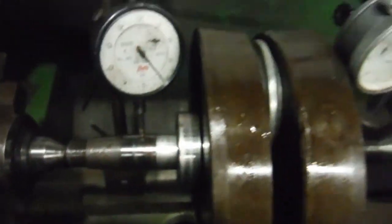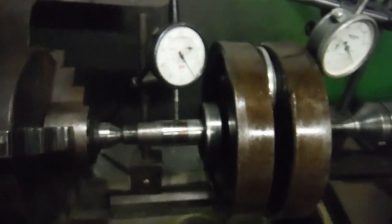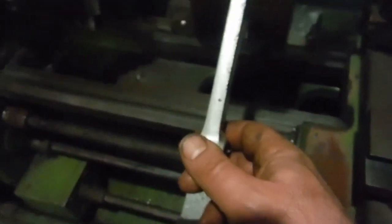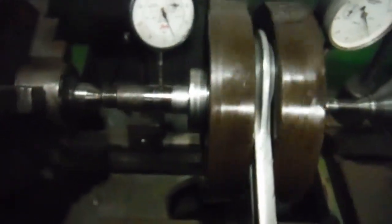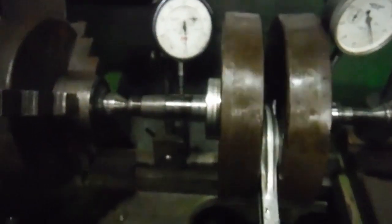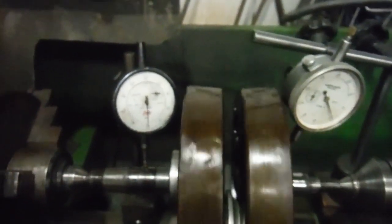I think under the circumstances it's probably going to be a good idea, in view of everything else that's happened with this machine, to split the crank anyway and have a look at the big end — and possibly even consider getting a replacement conrod if we can. They're not so easy to come by as the later post-1955 Bullet conrods, because these are narrower and they're not in stock at Hitchcock's at the moment. Anyway, for now I just want to spin this crank between centers and see what we've got.